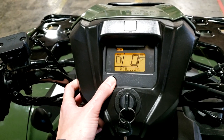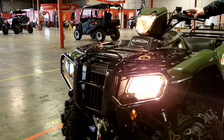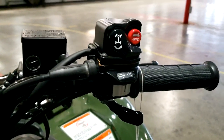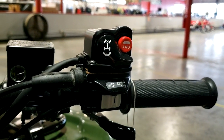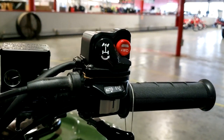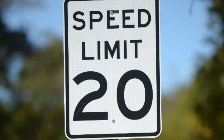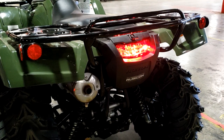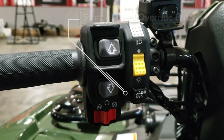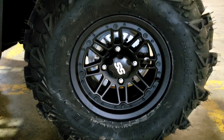When it comes to the four-wheel drive system on the Rubicon, Honda's Trax Lock 4WD allows both two-wheel drive and four-wheel drive with the flip of the red electronic button on the right side of the handlebar. You also have four-wheel drive with a locking front differential, engaged electronically by flipping the black switch above that red 4x4 button. When you engage the diff lock, you're speed-limited to 20 miles per hour. However, a speed override mode allows faster wheel speed with the front diff locked — pressing that override button on the left side of the handlebar increases the limit from 20 up to 40 miles per hour.